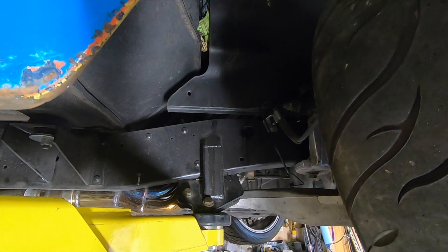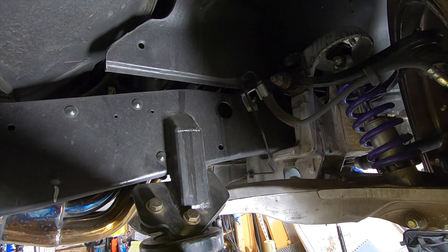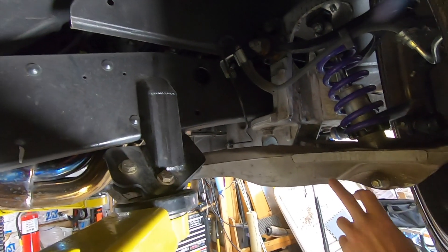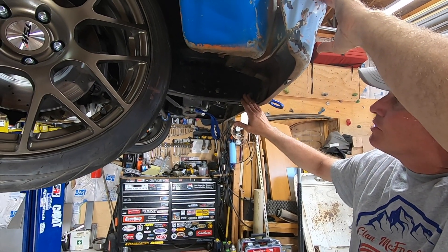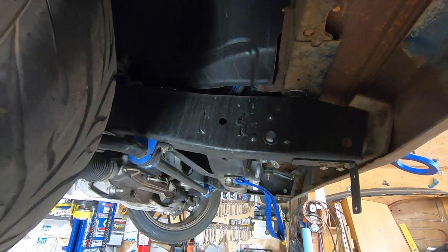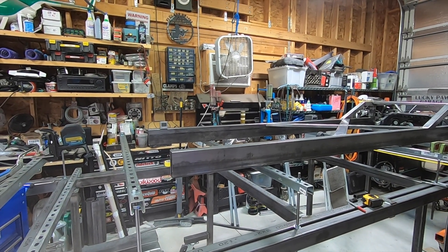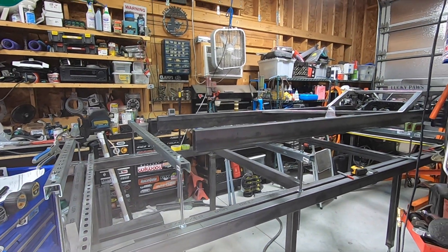The next step with the new frame is to copy this offset from the main frame beam to where the cradle for the front cradle sits. That will include re-manufacturing the mounts for the back of the lower control arms, then re-drilling and re-locating. We'll end up cutting out the frame stands from this frame and reusing them. We've got to make the front crossmember and the tie-ins for the bumper and core support, and we'll probably end up doing our new spline sway bar while we're at it. If you look at the table, we've got the offset from the main frame beams to where it kicks up for the front IFS cradle, so we're going to end up mitering those beams and extending them across this level.